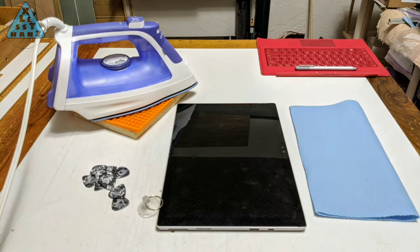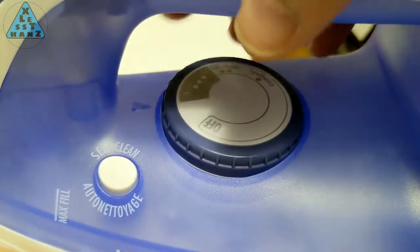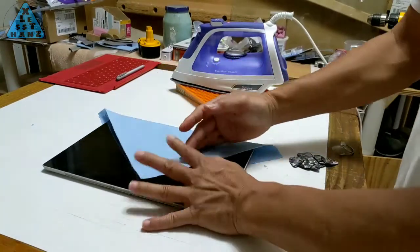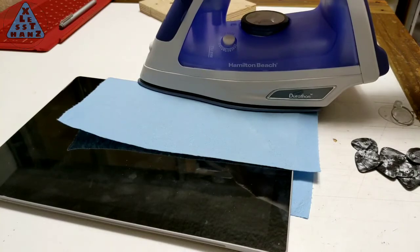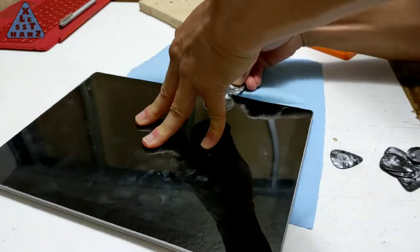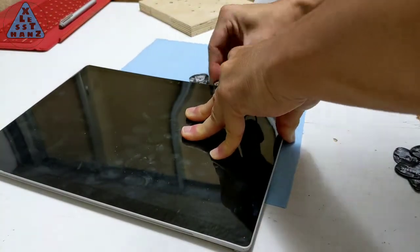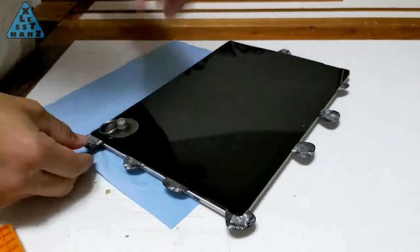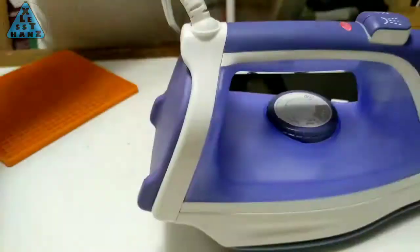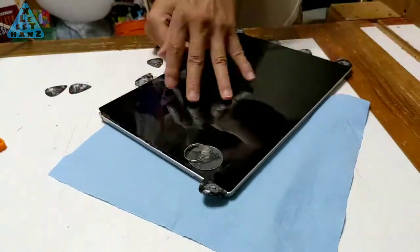After some thinking, I came up with a new idea that probably sounds as crazy as using a frying pan, but it's something I have around the home as opposed to a heat gun. Turn on the iron to max and wait for it to heat up. I also covered the tablet with a paper towel to protect it from scratches while I'm ironing. I'm winging it and going by intuition on how much heating it takes to melt the glue. I had to leave it on one spot for about a minute on maximum heat before I could lift it with the suction cup and begin prying.